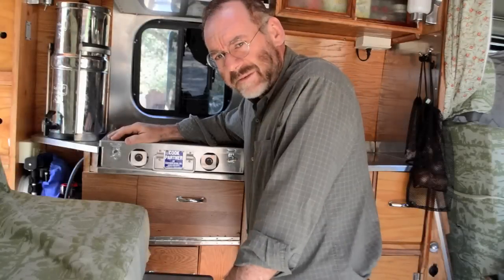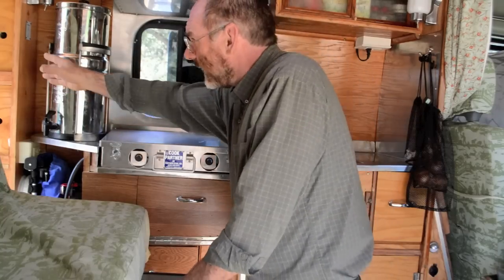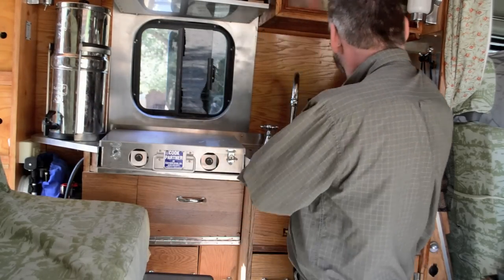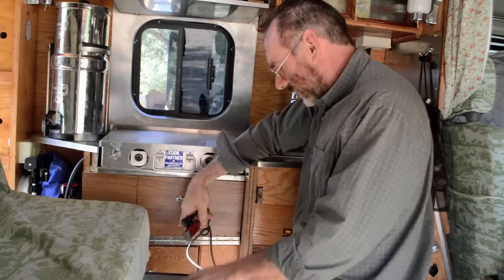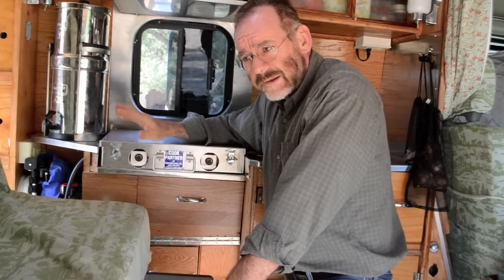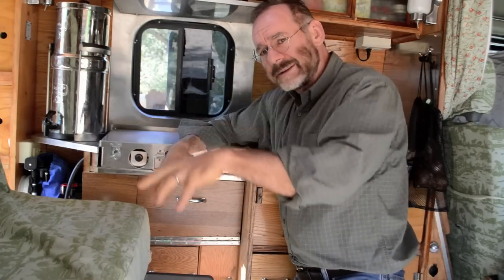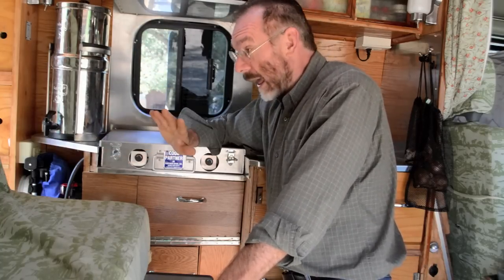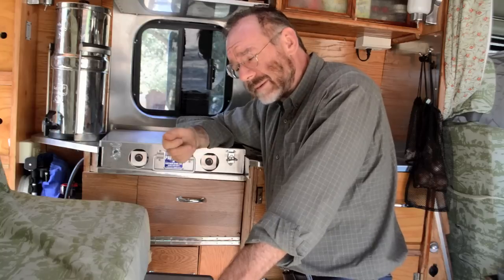This filter system is so effective that they say you can put pond water in here and it will be safe to drink. We have both AC and DC power. To get AC power — the kind of current you have at home — we have the inverter. Here's the switch that turns on the inverter, so anytime we want to use an appliance we just plug in. We have solar power and power generated by the alternator back to the battery bank — six AGM batteries — which means we can go anywhere and have both AC and DC. The only thing we cannot power in the boondocks is the big air conditioner, which needs shore power.